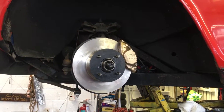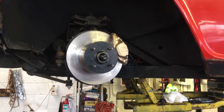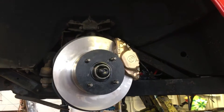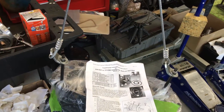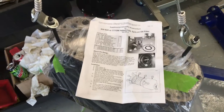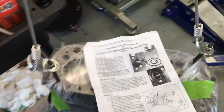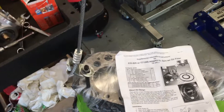My telephone number here is 513-793-0434. Feel free to call us after hours too if you get into any situation and need a question answered. This 76 TR6 — we did the engine rebuild, transmission, and we're going through the cooling system, braking system, and suspension system. Right now we're going to do this hub change. There also is a braided stainless steel line that takes the oil and brings it up through the back of the cylinder head, creating more oil flow to the rocker shafts, which keeps the rocker shaft and rockers in better shape. That might be something you'd be interested in even if your engine doesn't need rebuilding — if you'd like to preserve things and make maintenance easier, those would be some really good retrofits we'd recommend.